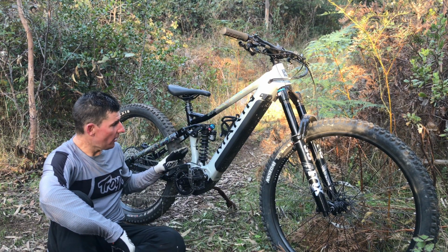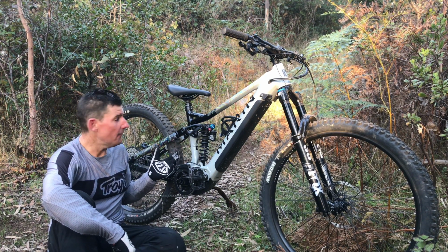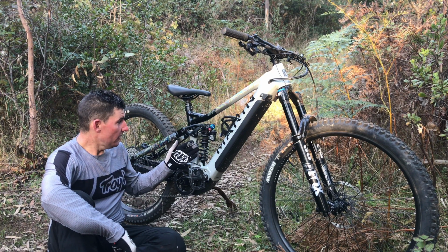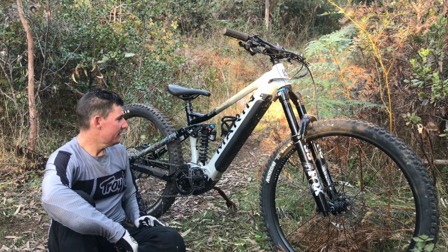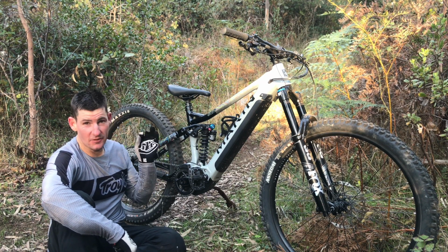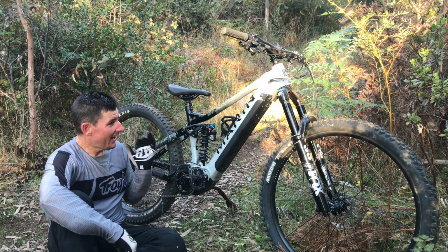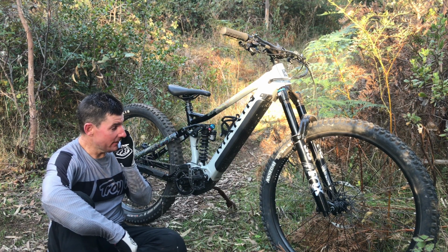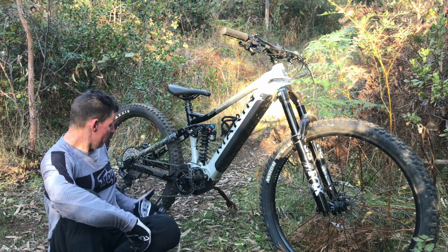handling, like the handling and ride height of this bike, 350 spring, 70, I'm probably 77 dressed up to ride, is perfect. No preload. It is killer. It is. I'm only just kissing the bottom on hard bottom outs, and if you watch the GoPro videos, you'll see where I'm bottoming, when I'm bottoming, and it's just killer. It is killer.